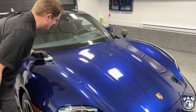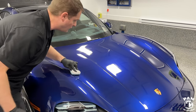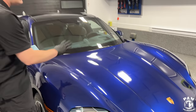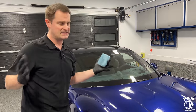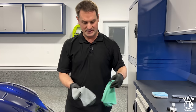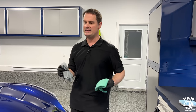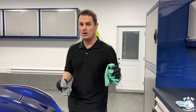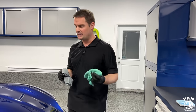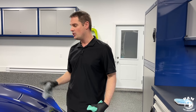This is very easy to apply — it's a DIY coating, so anybody can purchase and apply this. If you've waxed your car before, you can do this. After about 60 seconds — the optimal time G-Technic recommends — take two microfiber towels. The first towel is for the initial wipe to level the coating and avoid high spots. You're not buffing — you're leveling so you don't get darker spots from improperly leveled coating. The second towel ensures no streaks remain.